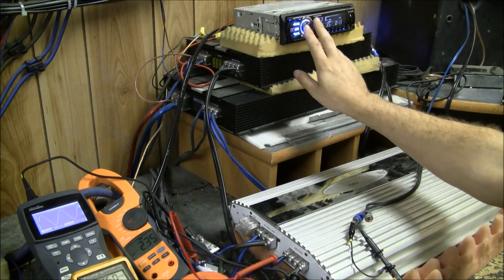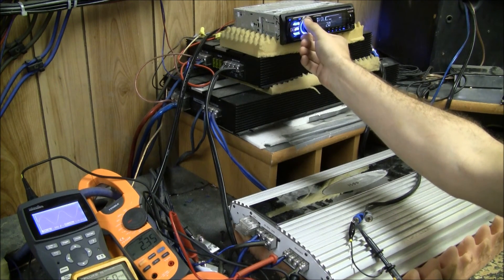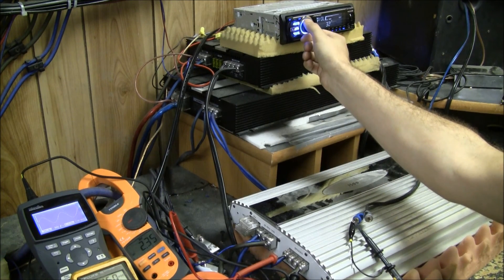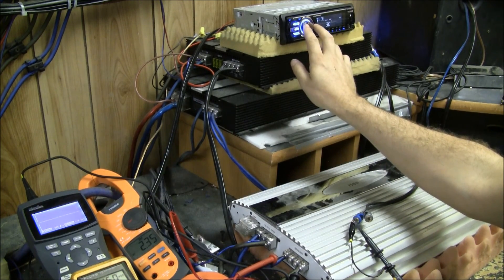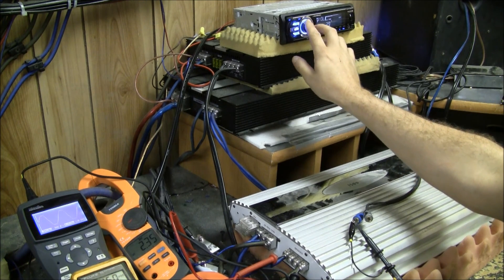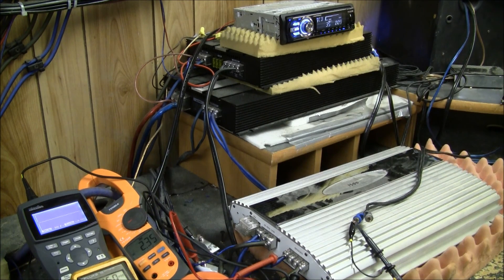You can also be clipping the head unit, not necessarily the amplifier first. So you can see here — we're up to volume 27, 30, still clean. Volume 33, 34, and finally volume 35, still clean. You go to 36 and it starts to get a little dirty; 37 is really dirty. So for all of that testing where I showed the amp clipping, we were actually at volume 15 when it started to clip. So there is a big difference between amp clipping and head unit clipping.